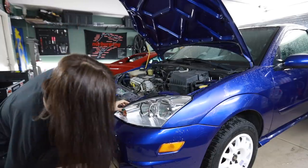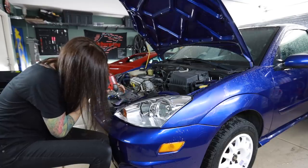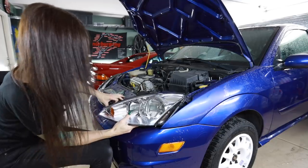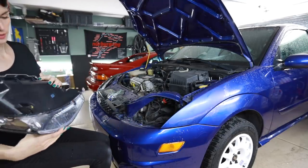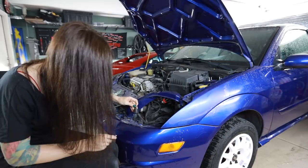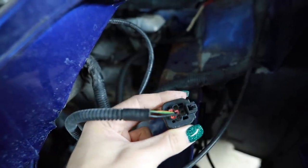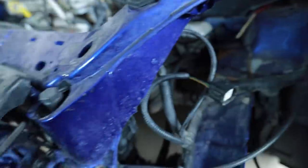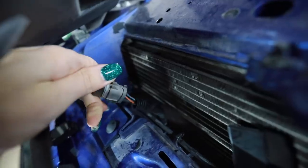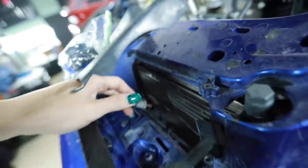I think I have to take the grille out - I forgot. Gently, gently. Headlight out. I've got a ground and then a potential for the high beam and a potential for the low beam. That means I've got to add a wire for my turn signal. We've got a ground and then two wires assumed for daytime running light and then turn signal.